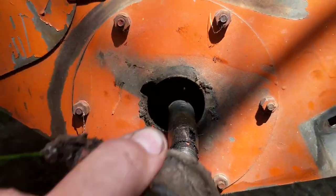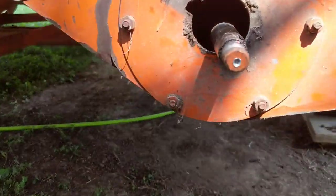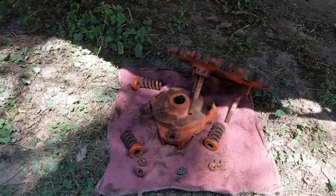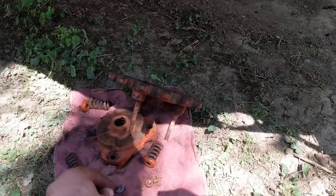Took a look at this one and this one is not attached very well either. Had a little bit of a time getting this clutch off because I tried taking it off as an assembly, pulling it with a three-jaw puller, but it kept binding up.